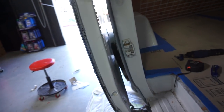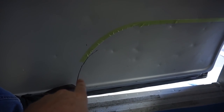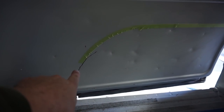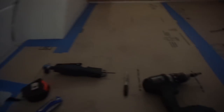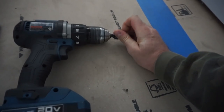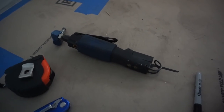While Ricky's fitting up the driver's side rear over fender, I'm going to go ahead and get this door cut so that we have the clearance we need — you can see where it's hitting there. I'm going to go inside the van and mark the door. This is basically the section I need to cut out — I'll go to the inside of this line and then down to there, just about a quarter inch further this way. I just traced the over fender, so I need to make a little more clearance. As far as tools, I'm going to drill a hole with a unibit from Metro Electronics or Klein Tools — we picked that up recently, seems to be a nice little bit. And I've also got our body saw that we'll use to cut this once we have the hole drilled.